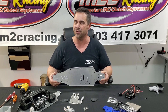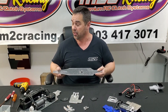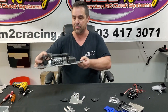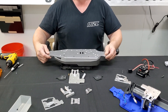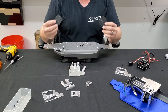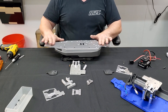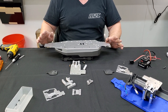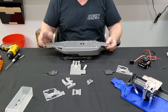You've been seeing them tested and you know they're tougher than nails. I wanted to show you some of the features that we built into the new chassis. I got one partially assembled here. First thing I want to note is that the bottom of our chassis is straight for strength. You're going to have to dremel down your skid pads in order to make them lay flat on the chassis. That's pretty much the only modification you'll need to make, because we 3D machined these surfaces so that all your stock stuff would fit.